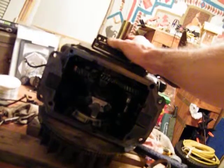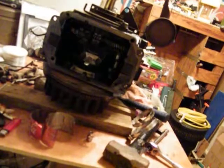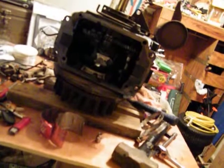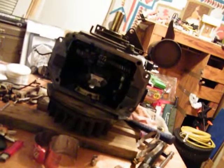I'm really going to like this though. I wish I had gear pullers so I could go ahead and put these seals in. I just can't do it all right now. First I need to put the whole kit in this thing, but I can't — I don't have all the tools to do it with. So I'm just going to put it back together now, torque it down, put it back together, put the head on it, torque the head down, throw some oil in it, and let's see if we got anything running on her.